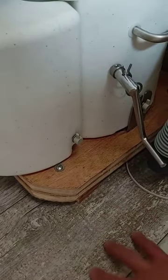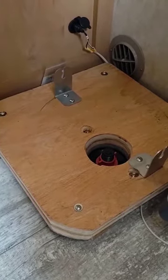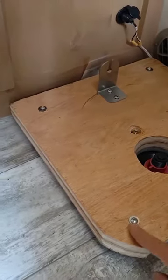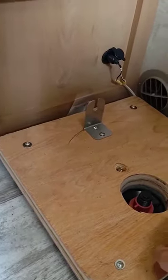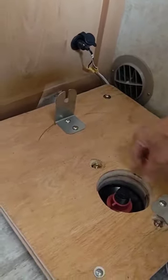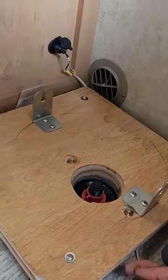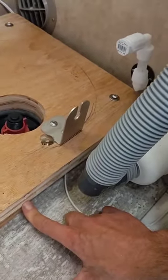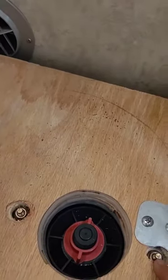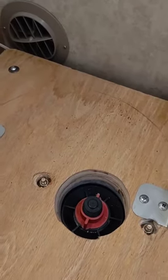This top three-quarter inch piece is screwed into the second piece, so I'm not affecting the integrity of the floor. I was able to screw these brackets into the top piece — here's the platform where the toilet is mounted. These four screws hold the top piece to the middle piece where the Air Head toilet brackets are mounted. The toilet brackets from the kit don't go much further than this three-quarter inch piece of plywood, protecting the floor. This middle piece is bolted down using the existing screws and rods from the original ceramic toilet mount, so it's very secure.